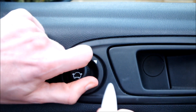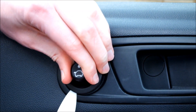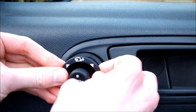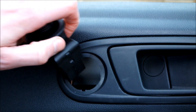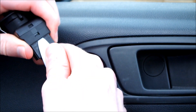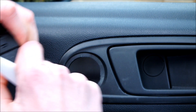Removing the switch is quite simple — just pull it to one side and outwards, getting the trim tool in the gap to leverage it out. Do the same on the other side. Looking at the bottom of the switch, you'll see there is a tab that has been clicked into place — just leverage your trim tool in between that until it is clear, and then you can pull it out. Fitting the new one is simply the reverse of that.